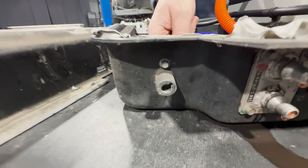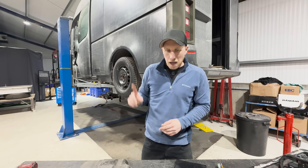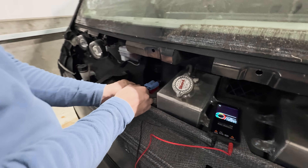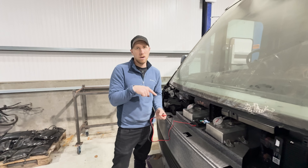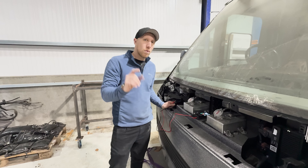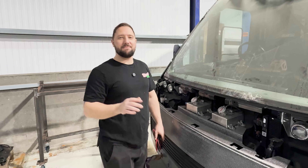This is going to be a 12V kill switch — which is not actually wired to anything, so it does nothing. Normally I think on the other vehicles that would have broken this contactor inside here. Now, more Arrival madness: up in the front of the vehicle we think there's some more 12V batteries, and after dropping out that 24V system at the back, on these little connectors we still have 12V on each one — meaning there are more batteries hidden in the front somewhere. In a future episode we're going to rip the whole front end off and I'll show you the full HVAC system that Arrival developed, because it's really really good. Thank you so much for watching — please like and subscribe!